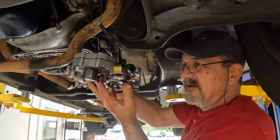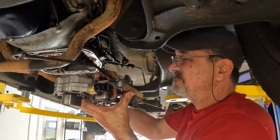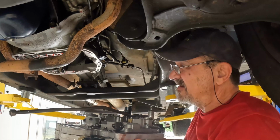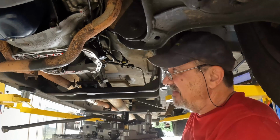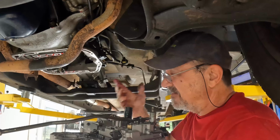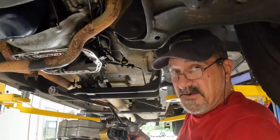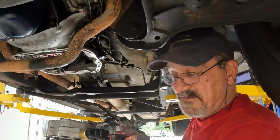Everything going through the wiring to the solenoid is good, and the solenoid, in theory, is good also. And unfortunately, that may tell me that the torque converter itself is bad. That's my next step. If just doing a fluid and filter change and manipulating the solenoid a couple times doesn't clear it up, then I guess I'm looking at a torque converter.